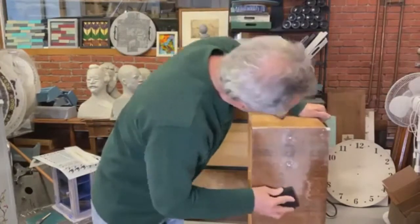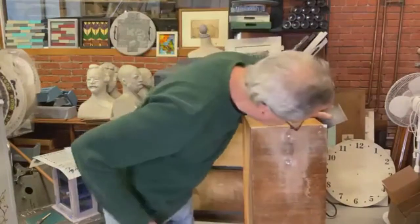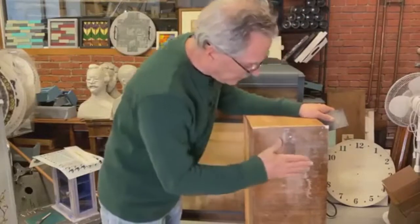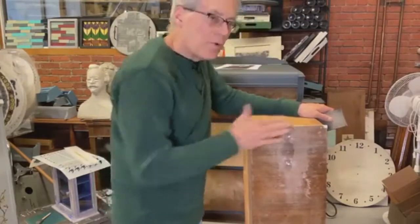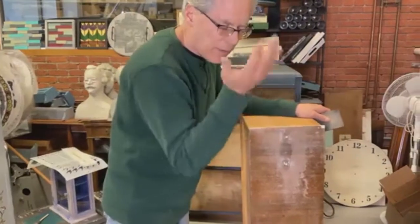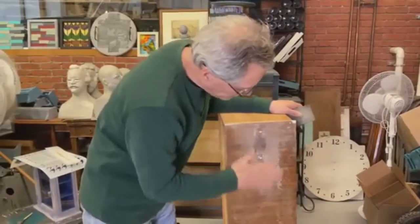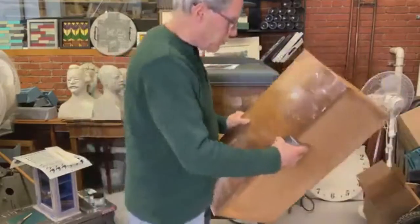And you're sanding by feel, I'm assuming. Sand by feel. This is going back to old auto body work. You just run your hand over it, and you should feel no bumps. If you close your eyes, your eyes don't take it away. You don't worry about what you can see, because we're painting over this. Worry about what you can feel. And so it's really quick.